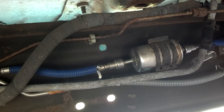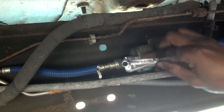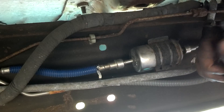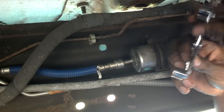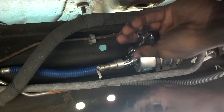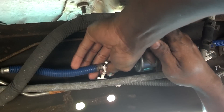These are quick-connect fittings on the fuel lines. This is what your new disconnect tool looks like — you can see the kind of attachments on the end. What you do is put it around the fuel line and inside the coupling. When it goes inside the coupling, it will detach the coupling from your fuel filter. Make sure you have the right size, of course. This tool costs less than $10 from an auto parts store.